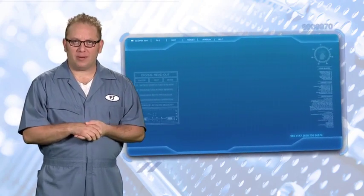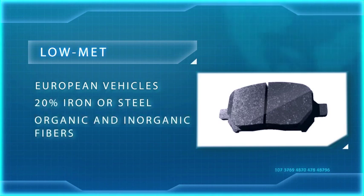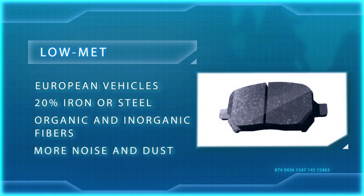However, we do want to touch on two more uncommon brake pads: low-met and sintered metallic. Does your customer drive an expensive European vehicle? You may want to check if low-met friction pads were used, because these are commonly found on premium European vehicles where higher performance is the goal. Low-met friction typically contains just 20% iron or steel and uses organic and inorganic fibers as found in NAO and ceramic pads. Unlike semi-met, low-met pads contain a complex mixture of lubricants instead of graphite, resulting in higher performance, but with more noise and dust. Low-met pads typically have more noise and dust than both ceramics and semi-mets. The final friction type — sintered metallic — is most unlikely to be part of your standard inventory unless you have customers with airplanes or trains.